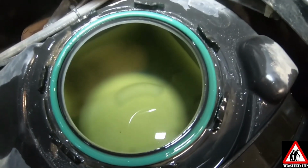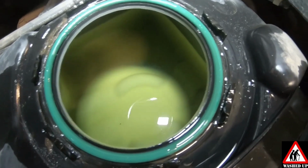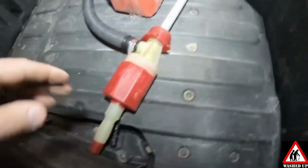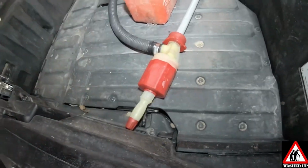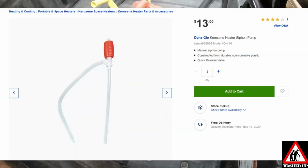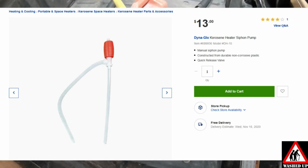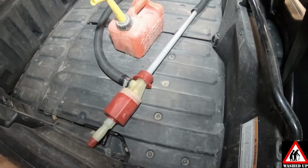And then I typically use this barrel pump that I've got, pump the fuel out, and then use a rag to get whatever excess. Now if you don't have a barrel pump, there's some little water pump, squeegee type deals. Smaller version of this. Yeah, this here's a 55-gallon barrel pump. So there are smaller versions of this. I've seen them at the farm store and that. I think they call them water pumps or something, but it's only about a 3/8 line coming out. A little better deal maybe. Anyways, pump that fuel out. Depending on what you're trying to do here, I guess. If you're trying to get water out of the tank, pump fuel out, dispose of it, put new fuel back in, put the fuel pump back in, rock and roll again.